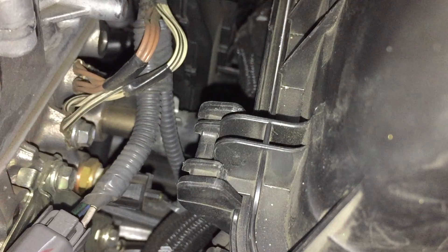You want to take the top part of the box, put the tab under that other piece on the left side, on both the front and the back of the box, and then set the box down. Then you can screw both the screws in on the other side. You'll know if it's not flat because you'll see the base of the filter sticking out, so you've got to make sure that both those are under there and snapped in. Then the box will be flat when you screw the two screws in.